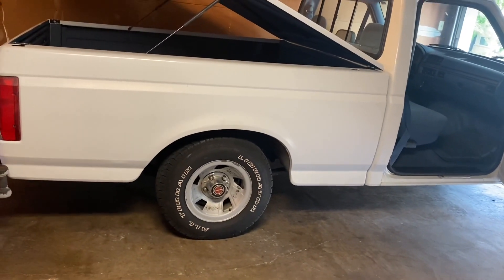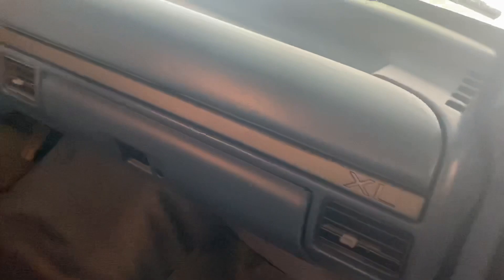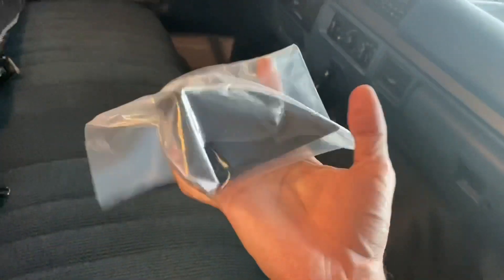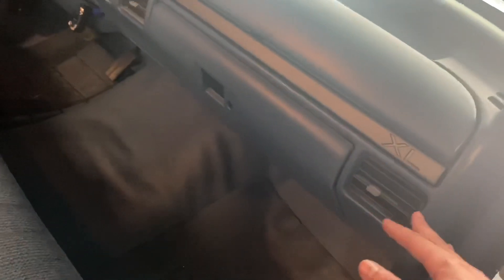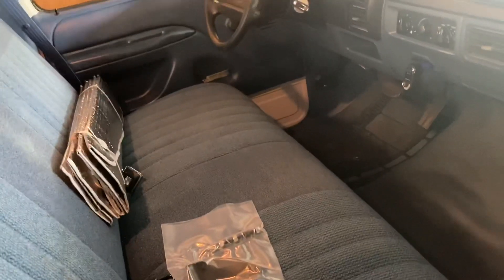My wheels haven't shipped out yet. I'm thinking they're gonna ship out maybe late August, so we're still waiting on those. But today what we're gonna talk about is door jambs and a rattly dash. This dash does not rattle, but I'm gonna put something on here to prevent it from breaking - this is a very very common spot that breaks on these OBS Fords. I got this bracket - I'll put the link in the description. It's a little brace that goes right here in the corner of the dash and holds it up. I did this on my Bronco and loved it because my Bronco's dash was pretty rattly before I put that on.